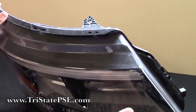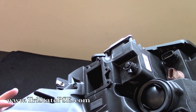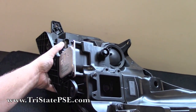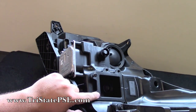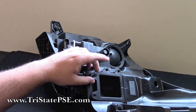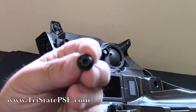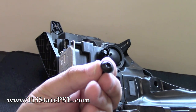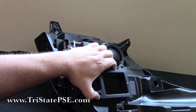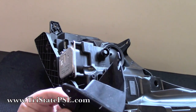Once you've removed the headlight, just flip it around. You'll notice on the back there's a little trap door. There'll be a total of five screws that you want to take out — these are little Torx bit screws, they are T25. We've already taken out the rest, and you just pop this little guy out, and he looks like this.